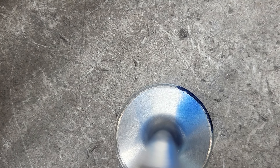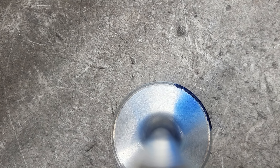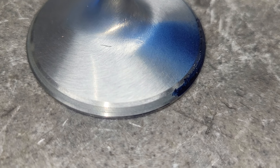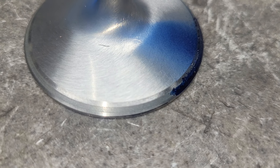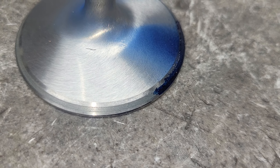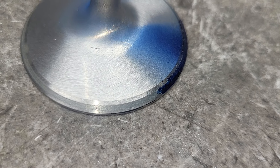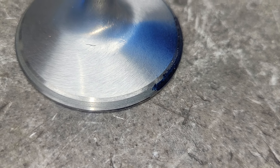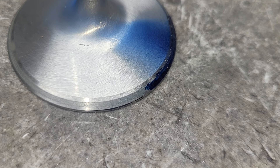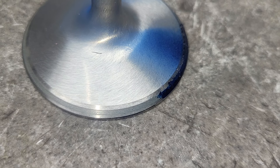You can see the lion's share of it is on the right-hand side, but on the left-hand side you can also see a nice powder. I should mention I put a small back cut on it — you can see where I just lapped it to find the seat, brought it up close to the seat, and it's going to be done. I could shrink the seats and gain some more flow, but I don't know if that's really applicable to this project. We'll see how we do before we spend time changing the valve job.